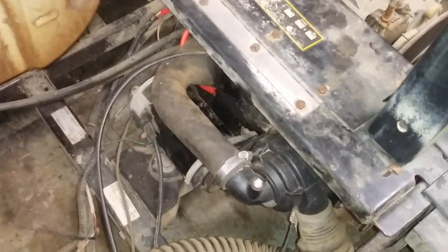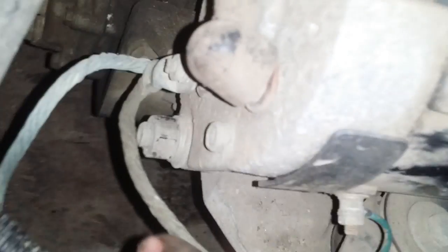Don't set the belt on anything warm. Now for the starter generator belt, I'm going to do the exact same thing but try to do it on the short side. Flip this back up and make sure everything's nice and loose. You may find it necessary to loosen the through bolt that holds the starter generator to the frame right here and back here.